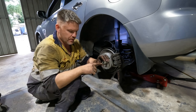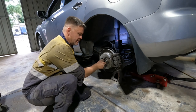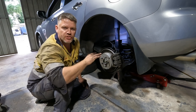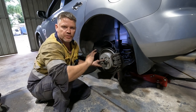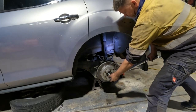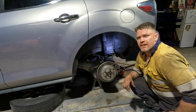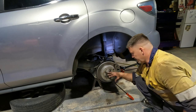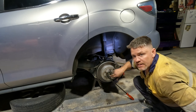With the brakes all back on, I've just put a small dab of Loctite inside the nut, put that onto the drive shaft, and tighten that up. I'm running off the spec for the wheel bearings which is roughly 270 Newton meters — about 274 I think it is from the book. I'll tighten that up first, back it off, and then tighten it up again just to make sure it's all seated. If the wheel keeps rotating on you, just jam the pry bar under there and it'll lock out — you'll get the right torque. The next thing we need to do is bash this little bit of the nut in so it locks onto the drive shaft.